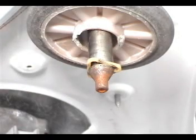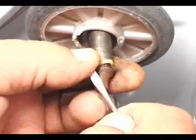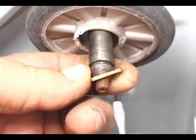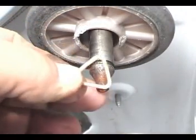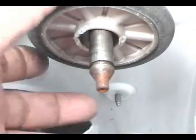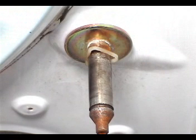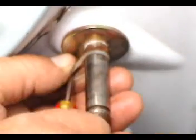To replace the bad drum rollers, the first thing you need to remove is this triangular plastic piece — using a small screwdriver will make the job easier. Remove the bad drum roller. If the plastic triangular piece on the back is good, just reuse it. If it is worn out, take a small screwdriver and stretch it out, then remove it.